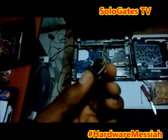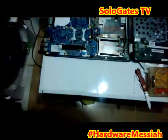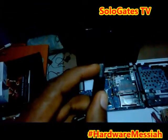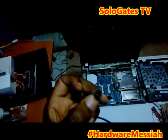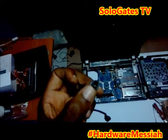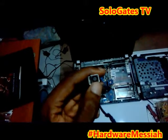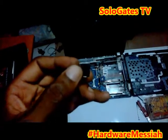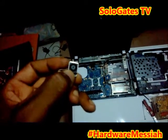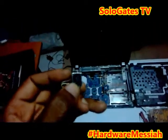The port has cables — red, yellow, white — and these connections. Inside the hole there are four stripes of metal conductor which connect to the metal here. This is possibly the neutral connection, and the pin within the HP charger is positive. The positive enters the hole and the negative enters the round cross-section. That cross-section has stripes within it, and if you use your charger for a long time it pushes those four stripes inside the casing and they lose contact — when that happens your charger won't work.